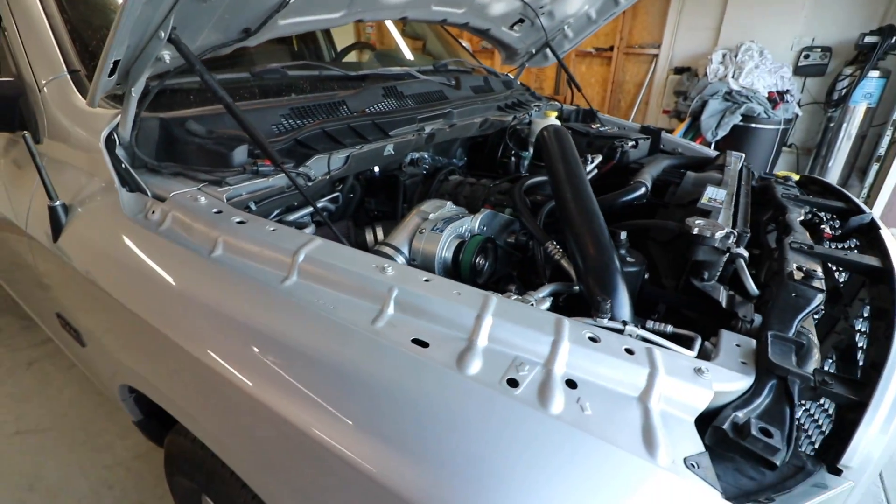Those are pretty much the two quirks I've found so far. As far as the whole thing itself, it works pretty good. I'm getting a bit of belt slippage — I'm getting about five, maybe six pounds at wide open throttle, where it's supposed to be getting seven or eight. I just have standard tension on it; I didn't tighten it all the way because you can tighten it more. I've read on the forums that people who contacted ProCharger are told to actually over-tighten it, even though the manual says only tighten it to the first mark. A lot of guys are having to tighten it past that first mark to get the belt tight enough to not slip and get full boost.